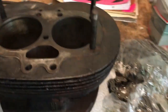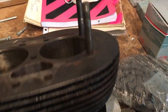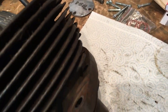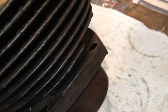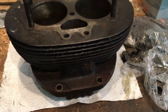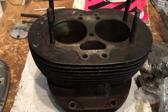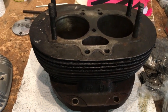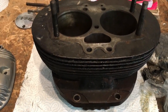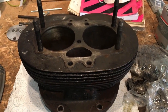We've got all the outer studs with it, there are no broken fins whatsoever, and subject to a bit of superficial cosmetic stuff which we can deal with by cleaning up and painting, I think we've come up trumps - we're going to use these barrels. The other option if they had been worn is that I do have plus-40 pistons, so I'd have bored this out to plus-40, but we don't need to do that.